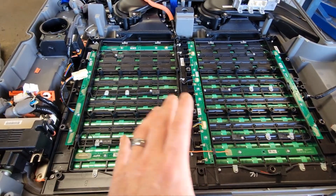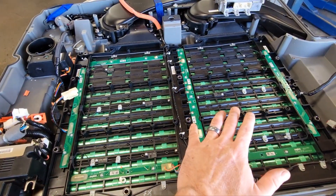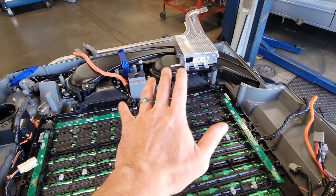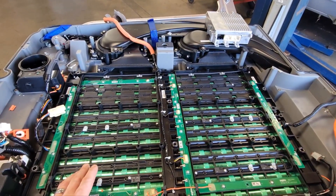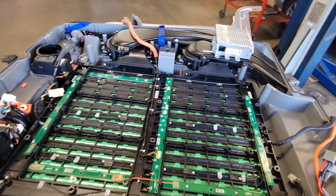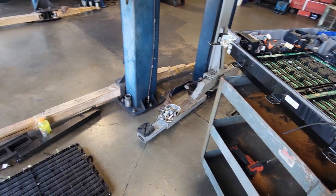The reason it was unable to equalize the batteries is that there are multiple cells in the lower module that have failed. The BMS was unable to keep up with equalizing the batteries and also failed. So we have multiple cells in this module that have failed and a BMS that has failed. I'm going to recommend complete replacement of the whole entire battery due to these reasons.